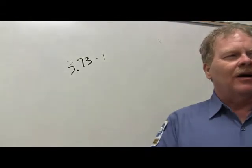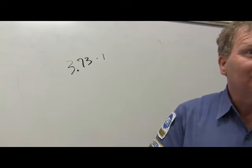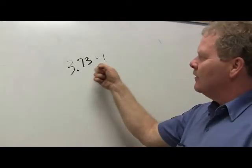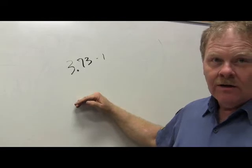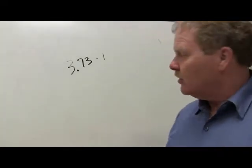Now, what happens on your hot rod cars with the stout engines in them? You put 4.11s in them or something, because you want it to be stronger. So anyway, 3.73 to 1. What is this going to do to your gas mileage? Probably going to shoot it in the foot if you started out with a lower ratio, unless you got bigger tires. Yeah, that helps a little too.